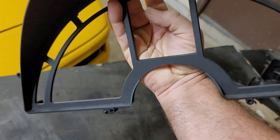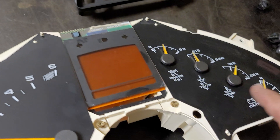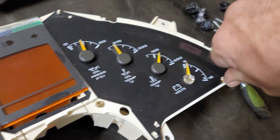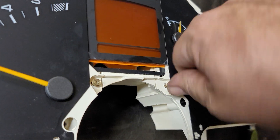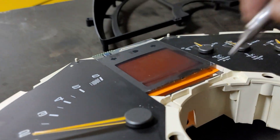There's our outer bezel — you can see the GM part number on it. Everything has a GM part number so you could look up individual part numbers if you wanted to. Now what we're left with is the face, the LCD, and this has to be done really gently. The LCDs are what usually go bad on these — they either crack, or the sandwich separates and the LCD fluid leaks out, giving you spotty half-looking numbers that you can't read correctly.